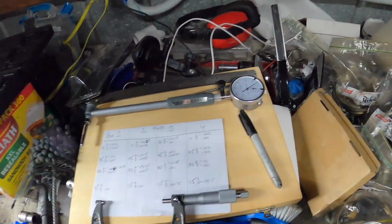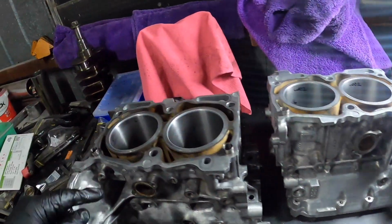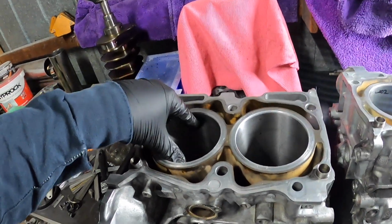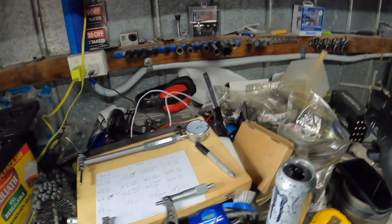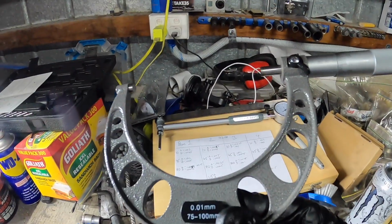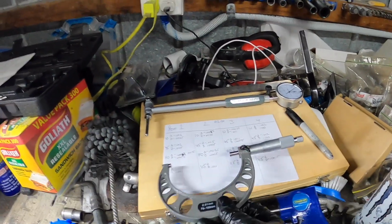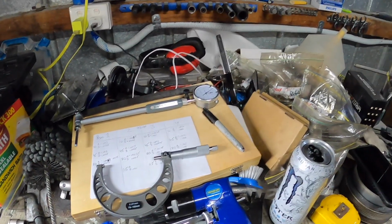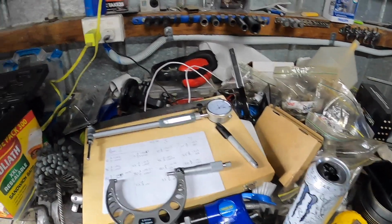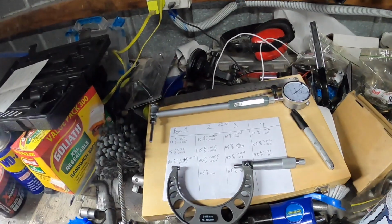And then, yeah, there's only one that's 92, and that's the piston or bore 4 this way at the 10mm down. It's the only one that's at 92. Now I did quickly put it onto piston number 1 to measure that, and it's not 92. So I need to measure up all the pistons again, and I'll write them up the top here. So that's down the 1.1 inch on the EJ20 with a 75mm stroke. I've got to measure it down. Yeah, 1.1 inch. So I'll write them up here, and I'll work out maths.